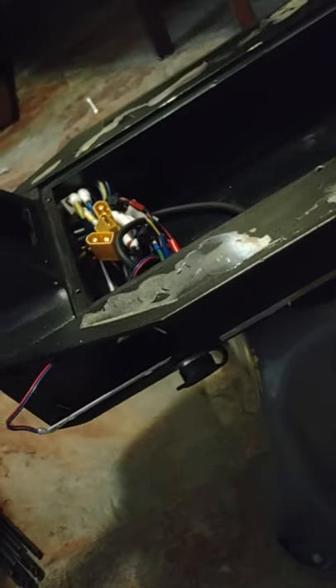That's about all I've got for sealing the Mantis 10. Just make sure you pay attention to where wires are and where there are little holes — there's a hole right here with a bracket that goes through it. I put a little bit of silicone in there so when I put the cover back on that hole is for sure sealed up. They do seal the rear pretty well from the factory — it's a pretty good seal there. Hope you guys don't get your e-vehicles ruined by the rain. Thank you.